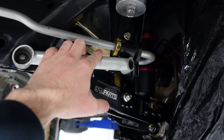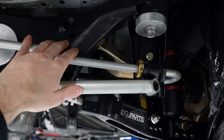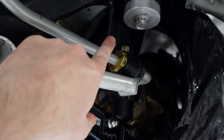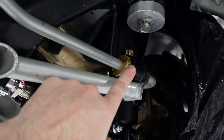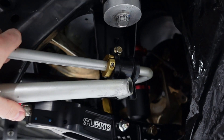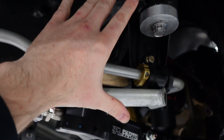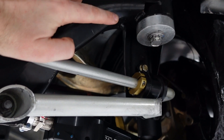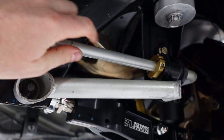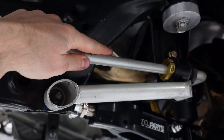One of the advantages of testing this in the car as opposed to on a test bench is that we're including the added-up stiffness of everything the anti-roll bar is connected to. In an OEM car like this, where you've got a factory brace and polymer bushes holding the anti-roll bar, you'll get a significant amount of deflection not just from the torsion of the anti-roll bar but also from a lack of installation stiffness. In a proper purpose-built motorsport application, all of these components would be much more solid. If any of the bracing components are moving, it makes the anti-roll bar a much less effective tuning tool.